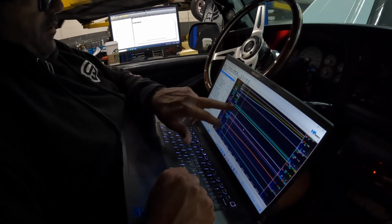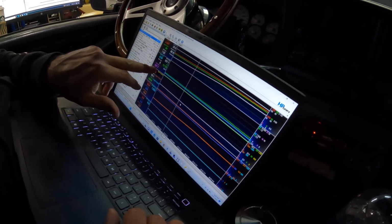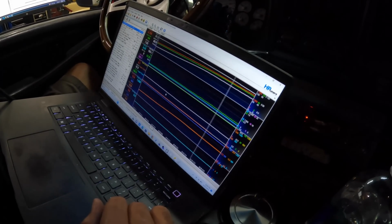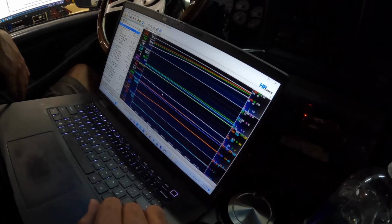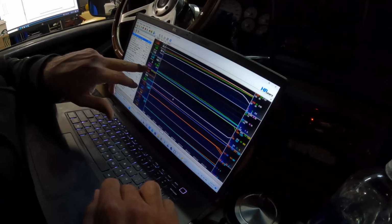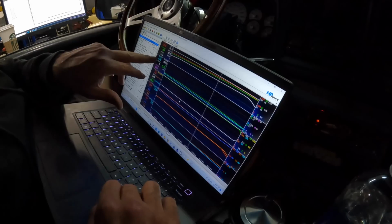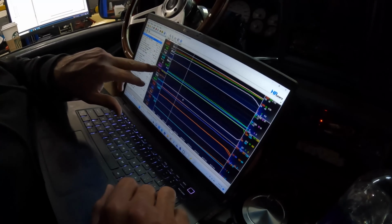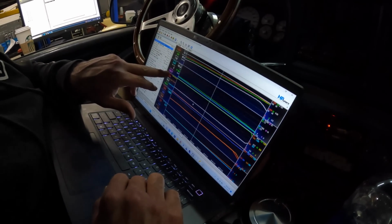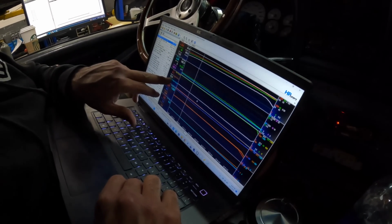But here's a log right here. We're in the high 11s. Here's boost in kPa, map pressure, 11.7, 11.8. We hit a little bit of 12.0. Then it goes back down to the 11s. Right there, 11.8. Boost is steady. Boost is 180 plus the whole pull. Ends at 187 at 54. The problem area at 4,800, there's nothing happening. Boost moves by what, 1 or 2 kPa. That's a quarter pound of boost. Timing is flat, 15.5 degrees. You can see that line flat all the way across.